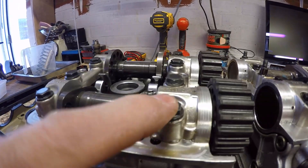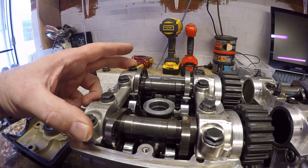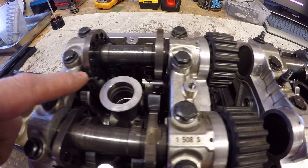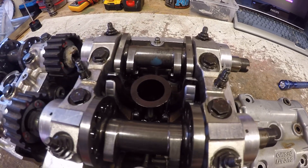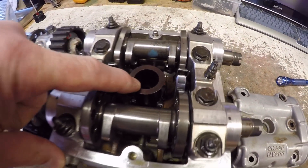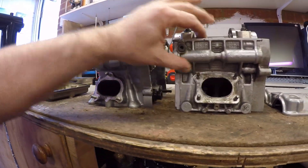The later arrangement looks much easier and tidier, and doesn't form part of the integral cam cover holding arrangement — which is good, because nothing's worse than stripping one and not being able to hold your cam cover correctly. The rocker arms look very similar in construction but with a much tidier casting process and more ribbing. The spark plug tube is part of the casting on the later head, whereas it's a machined component fitted into the earlier engine. Ducati clearly got much better at casting technology on the later engines — and the later head feels slightly lighter.